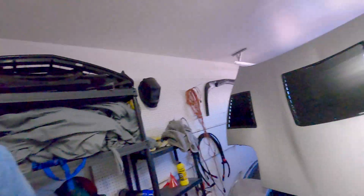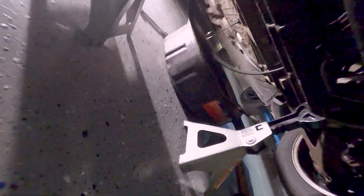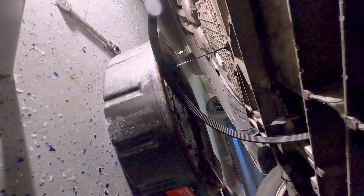I've never actually drained the oil in this car, but it's looking quite watery and frothy — just kind of not good. It definitely looks like it has a blown head gasket with some water and oil mixture. I know the actual cooling system doesn't have any oil in it, so I don't know what's going on. Somehow oil or water is getting into some of the oil passages.